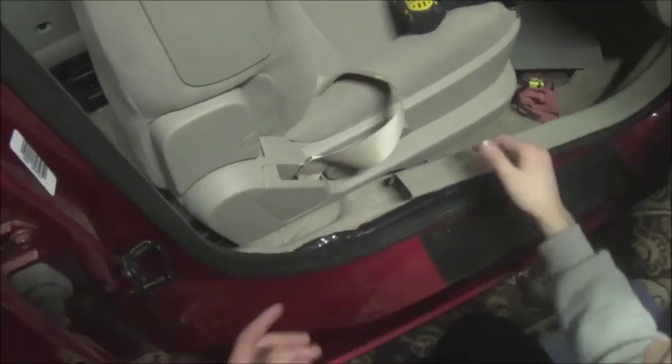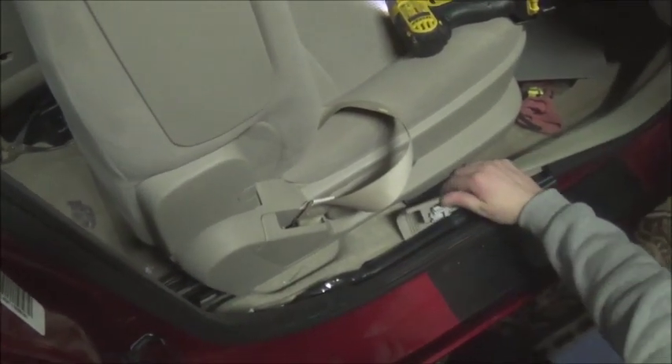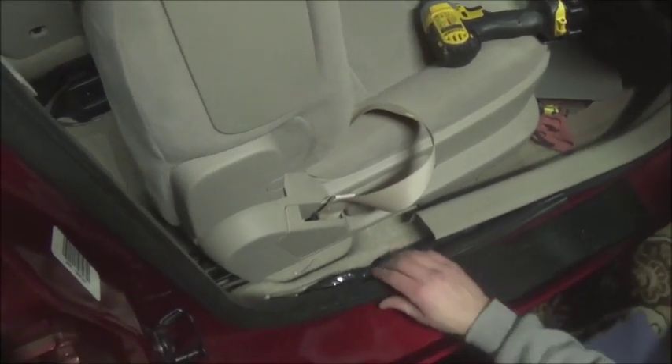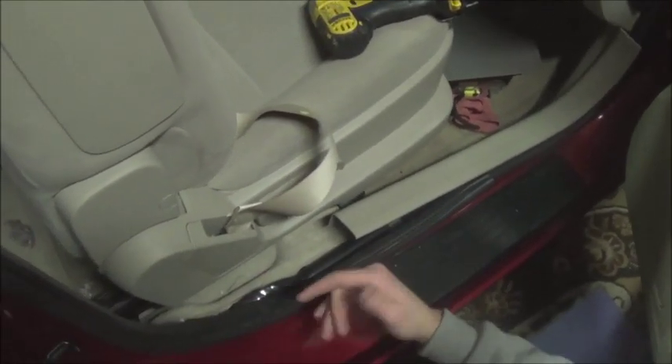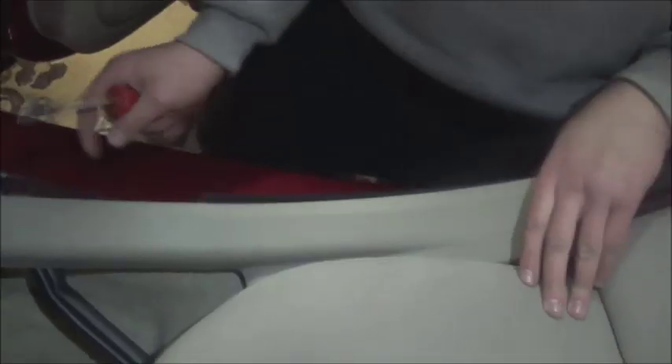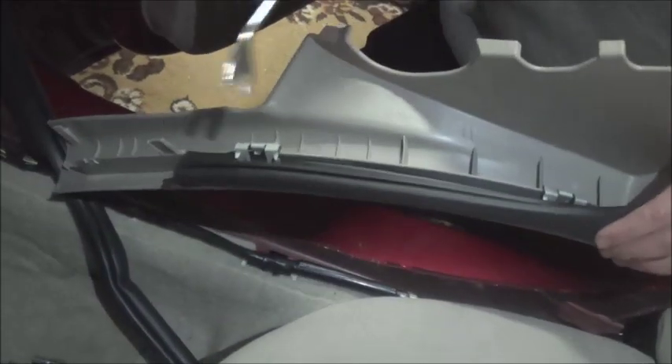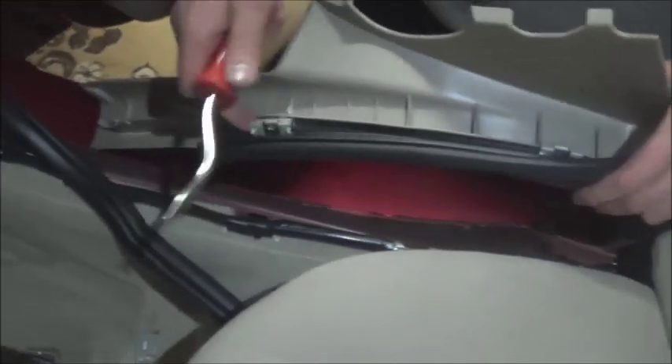That part's done. Next I'll show you how to get these rocker panel clips back in, because these are kind of a pain. You have to pull them out, put them on the rubber weather guards, and then slip it all in. I left the center console off for now with the seat belt installed. We pulled the rocker panels off pretty easily, but putting them back is the hard part — Ford's clips are already on there.